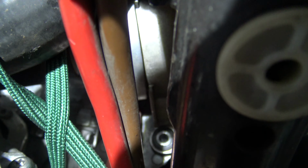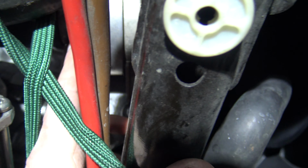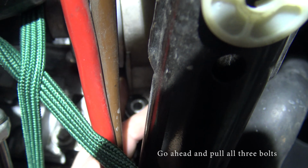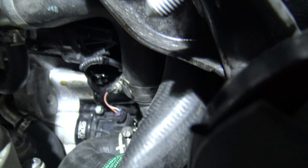hopefully, I got my finger here where you can see my finger. So you'll see right there and right there, where I've got two empty screw holes, right? Right there and right there. Those are E12s to move this pump. Those are reverse Torx E12s. And so then your pump has two bolts at the bottom and one bolt at the top, so it'll pivot on the top one. So then I took a tow strap around the hose for the pump to pull it out of the way,